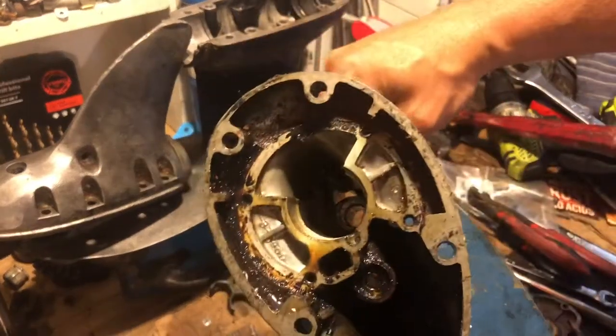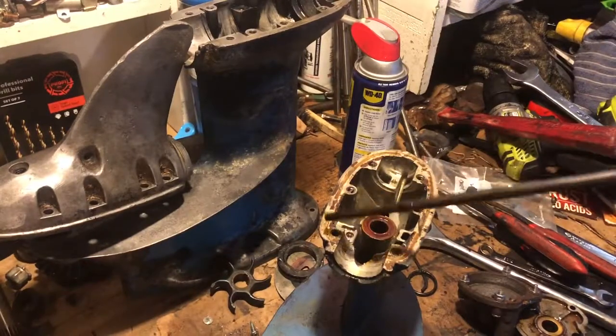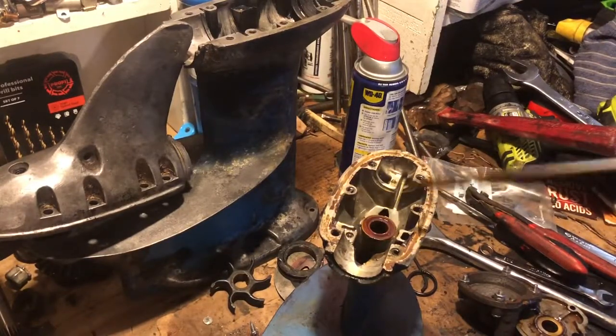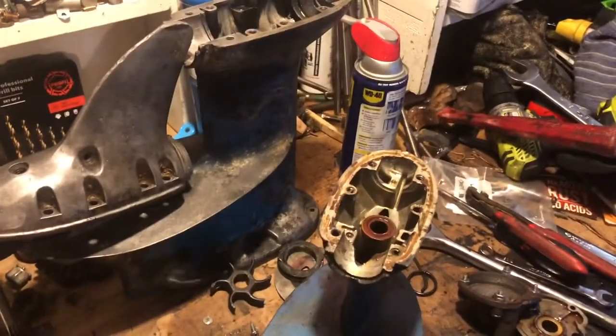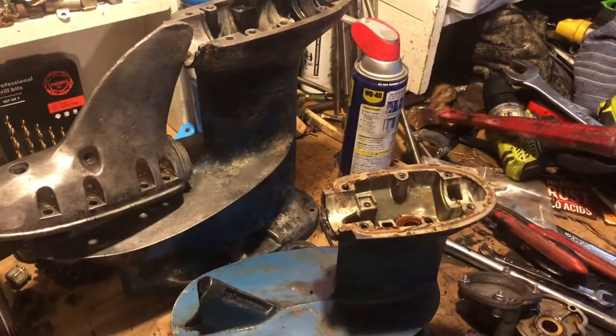The bushing's right there. Taking the skeg off was just six bolts — they weren't even tight, kind of loose. One, two, three, four, five, six. The typical four on the leg — because it's a 10 horsepower. On the fives and sixes you have to pull the power head to get the lower unit off. The 10 horsepower and up has a plate — you just disconnect the shift linkage.